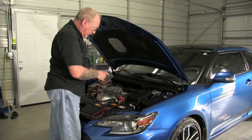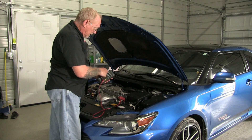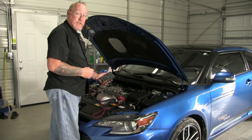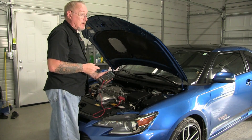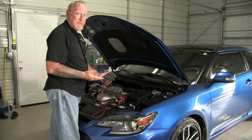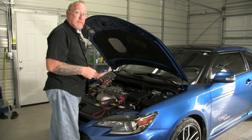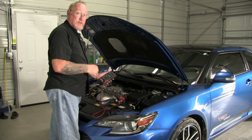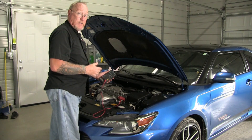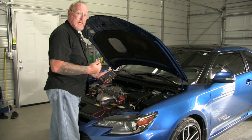Now that I've completed the cycling — the start and run cycle — I'm going to hit the minimum button again and we get the high of 13.98. That's charging system voltage. Now that figure is not the common 13.5 to 14.5 that we all grew up on. It can vary depending on the kind of car you're working on, so be sure you check your service information system for the specifics of how that charging system functions. Some models will have a much higher initial charging voltage for maybe the first minute or so before it tapers back off.